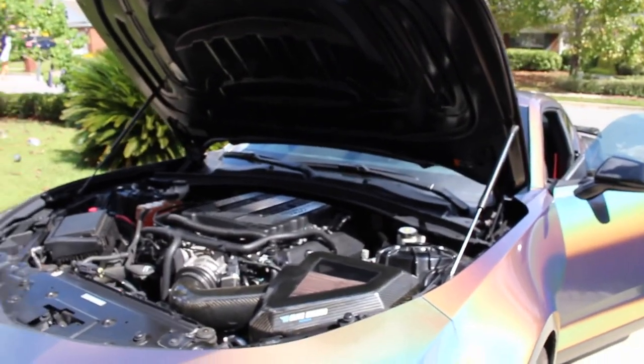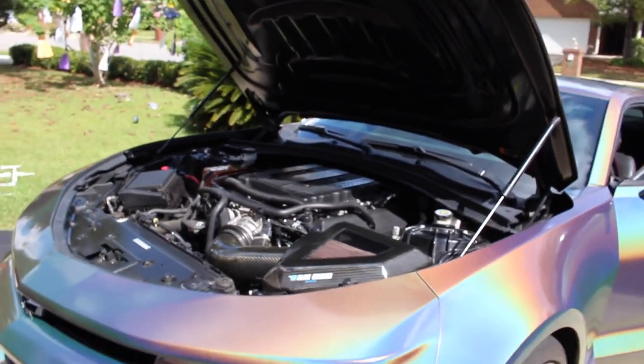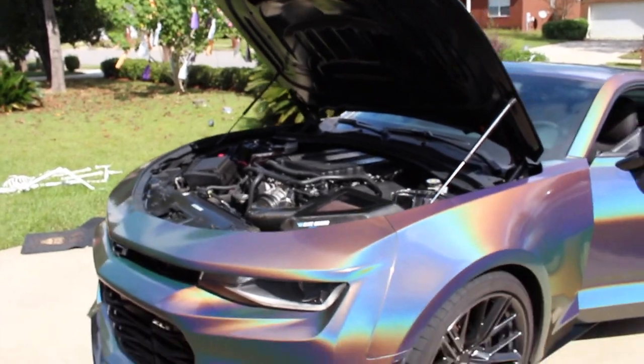Hopefully we'll have a little better luck with the supercharger and the heat soak issues we've been having. Maybe it'll last a little bit longer before it starts losing horsepower, because I saw these things lose quite a bit of power just from heat soak — I'm talking over 100 horsepower to the wheel on a C7. That's something I'm going to be careful of. I wanted to touch on the cooling system — I mentioned this in the one-year anniversary video when I talked about upgrading the car and doing something with the cooling system.